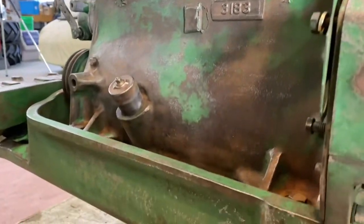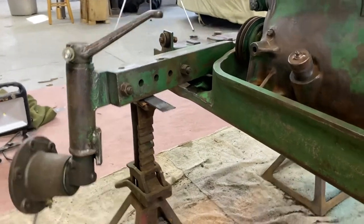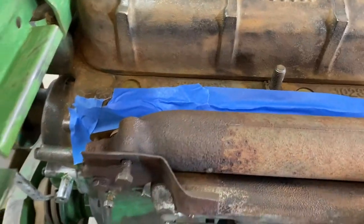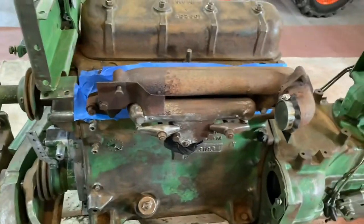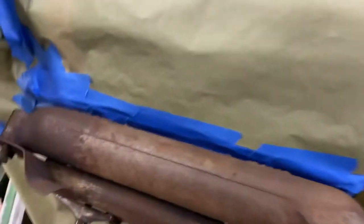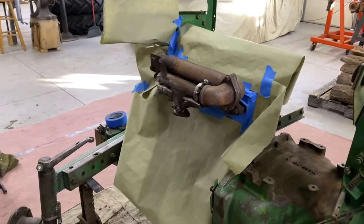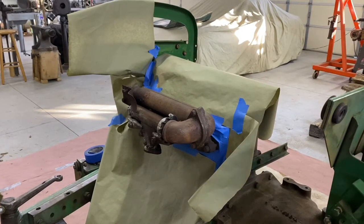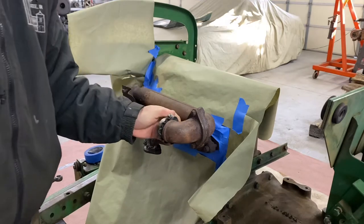I've done my best to really get the engine area good, the frame as well as I can, same with the axles. I've really taken a lot of time to get this thing as clean as I can. It's not going to be a concourse restoration. You can see where I'm taping off the manifold. I'll take some paper and run it on the backside and the underside, then shoot that with some high-temp silver. I've got the intake side covered with some rubber. The muffler actually clips over this, so none of that rubber will matter for the most part.